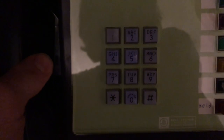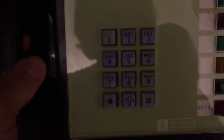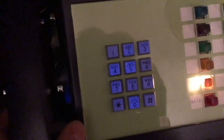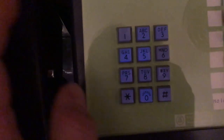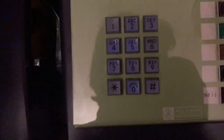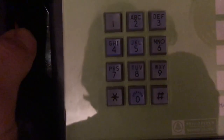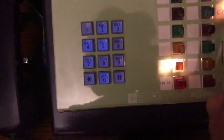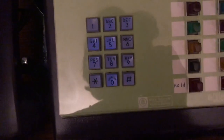If you want to get creative and make your own LED circuit, I did that for my call director — I made a custom speakerphone-compatible Princess phone type dial and I just used some blue three millimeter LEDs inside with a capacitor to make a slightly dim fade-out effect instead of just straight on and off. This is also compatible with my speakerphone that activates the colorized glowing dial.